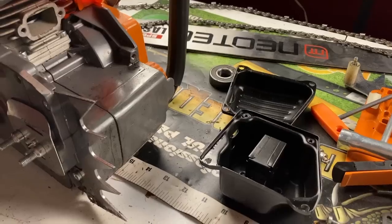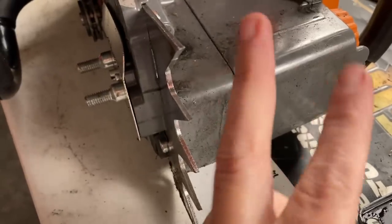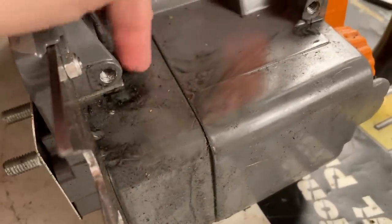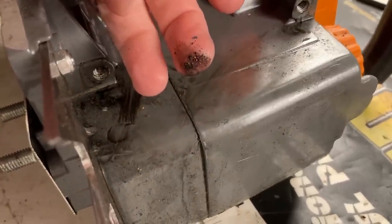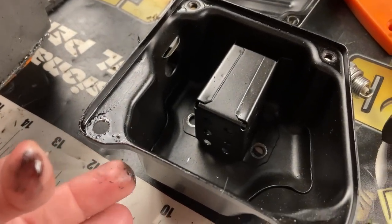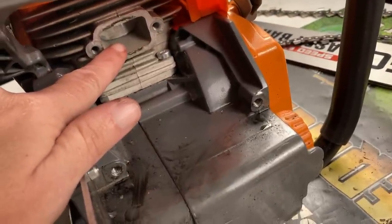I didn't figure it out until I removed the muffler. The piston in there actually still looks beautiful, so that can't be it. But I saw this oily black chunky residue, and for running only 20 seconds with the customer saying it was just flooding fuel through, I was wondering what this black stuff was. I figured out it's the muffler — it's brand new paint that was being washed off by the gasoline, and the chunks that came off when the bolts were put in went back up into the cylinder. Did that score it? That's my assumption. Do you think the paint chunks scored the piston already? Leave a comment below and tell me what you think.